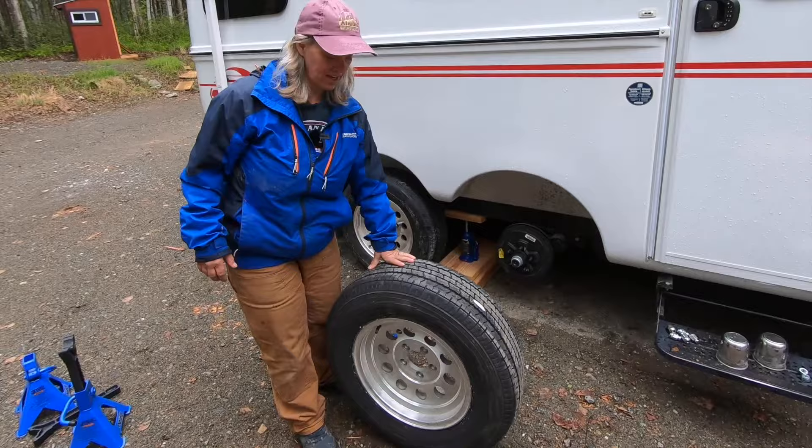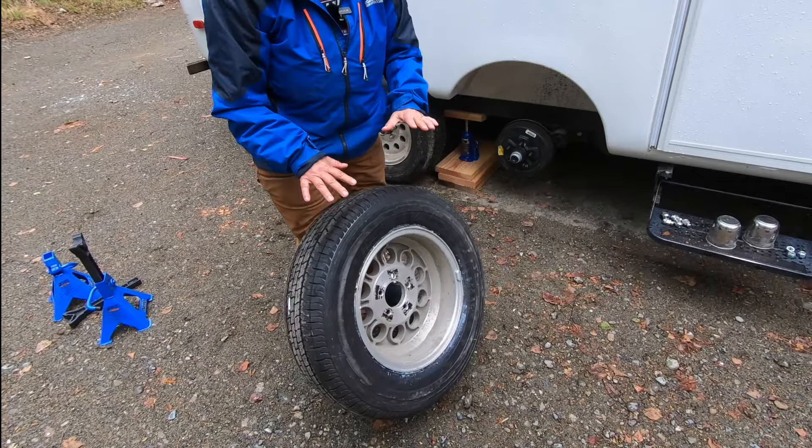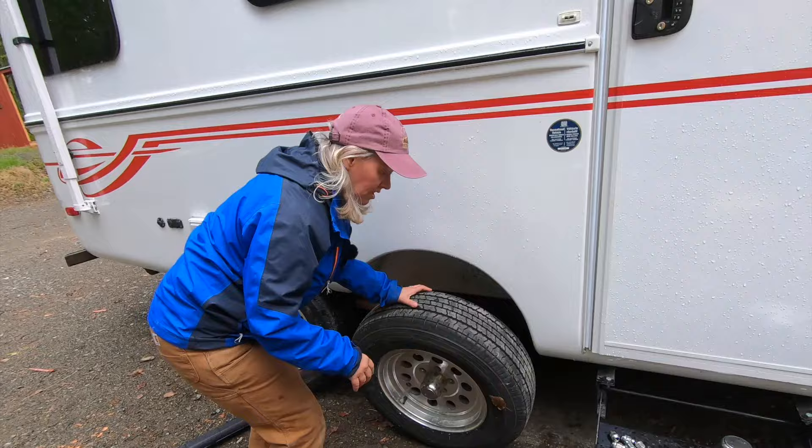I got my new tires and I'm going to go ahead and put this one back on. One of the things is — see this right here? That's a balancing tab. Most RVs do not come with tires that are balanced. So it is a good idea to take them off and go get them balanced. I've jacked the bottle jack up a little bit again. Don't forget to put these back in — I almost did. Now I can line this up, stick the tire back on, and put the lug nuts back on for both sides.